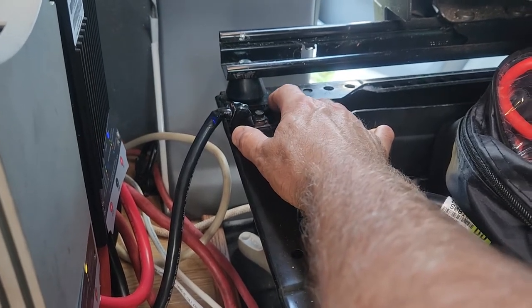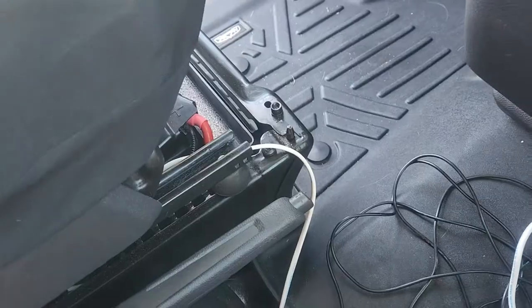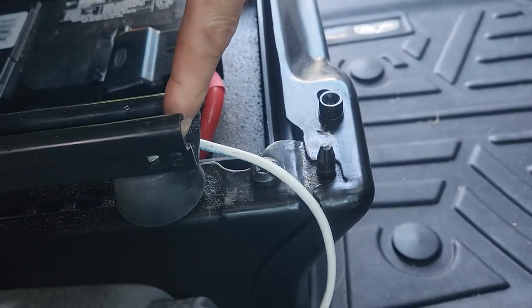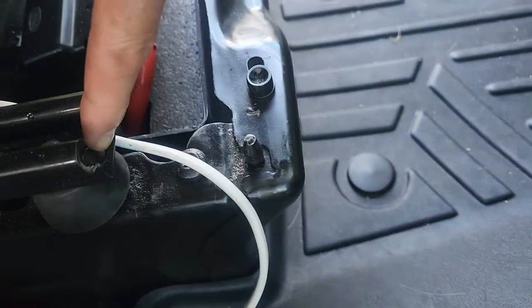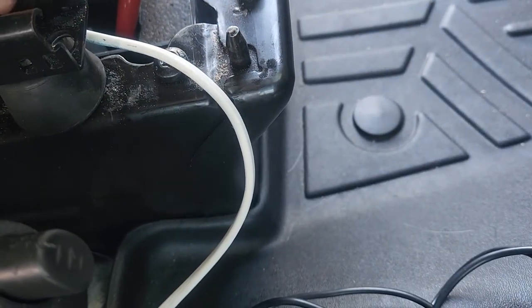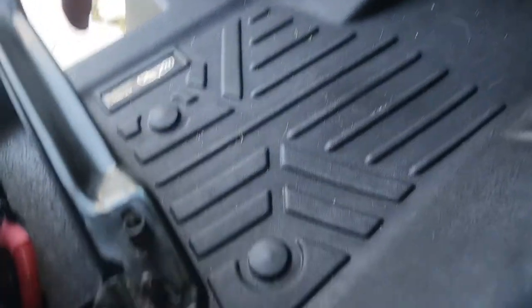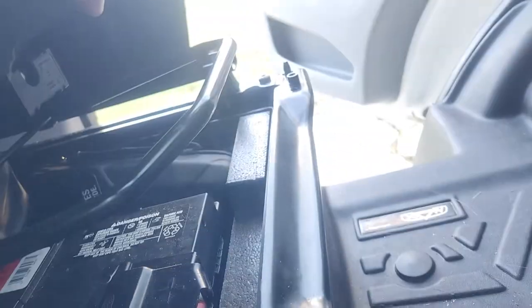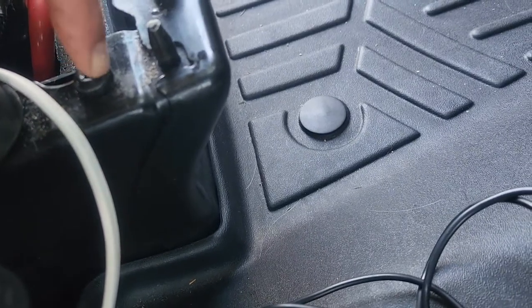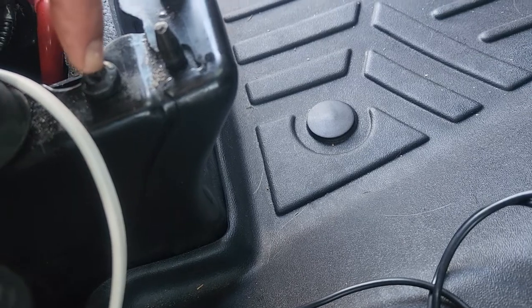When you're drilling that hole, you'll have some frayed metal parts to vacuum up. Here's what it looks like from the front — the factory setting had the hole here, and it's moved back a good four inches, which helps substantially due to that bump from the wheel well. Same thing on the other side. I put the factory screw back in the original hole so it doesn't rust in case I resell it and someone needs it back to the original position.